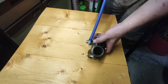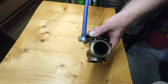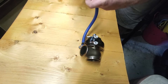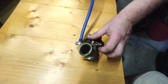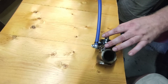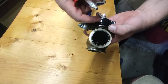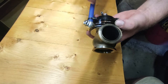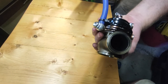So I've got the compressor set up, just allowing 10 psi of pressure. If you can see in there, I've got the piston. What I'm going to do is put some pressure into the vacuum pipe and give it a bit of pressure. And what I can do is actually feel the air coming straight out of the top port — which is no good. So it looks like we've got a diaphragm problem inside there, because that should be sealed and that will cause the piston to lift up. But instead, the air is getting past the diaphragm and coming out of the top port. So that looks like what my problem is. I'll get this stripped down now and see what's going on inside.